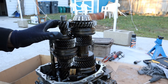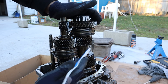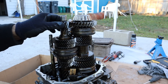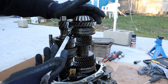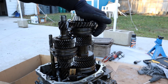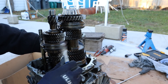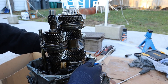Fifth gear has a much larger gear on the counter shaft side — that's an overdrive gear, typically used on the highway where you want your engine turning slow and efficiently while the wheels spin fast. Fifth gear shares its synchronizer with reverse gear. Reverse gear, which freewheels on the counter shaft, uses that little idler gear we saw inside the transmission case sitting in between — running power through that extra gear automatically reverses the rotation direction. Reverse has a similar diameter to first gear since it's used at lower speeds. So all in all this transmission has just three main shift forks: for third and fourth, for fifth and reverse, and for first and second — which mimics the shift pattern on your shifter knob.